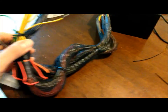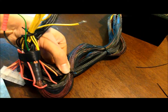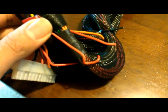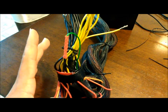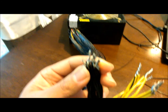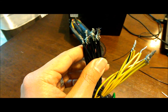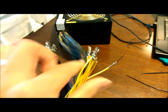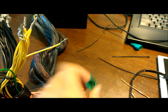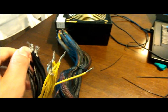I'll put a couple more cable ties on there. Got one tie here, another tie here, put a band right here. The reason I left these connectors on is I didn't want too many loose wires hanging around — you could cap them off if you want to be ultra secure, but I'll probably just throw some electrical tape on there. I have every connection out and not bound so I can always see what's what. There are a lot of ground wires, so I think I'm going to end up splitting this off into two sections. There aren't as many 12-volt yellows, so those can all fit into one fairly easily. I'm using the super-large wire twist connectors, and now it's time to get started on the next phase.